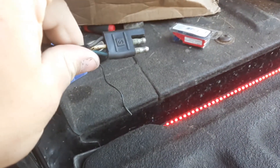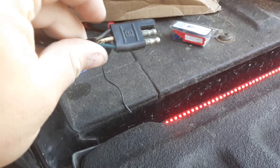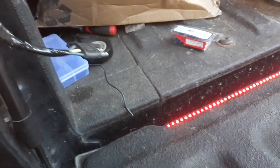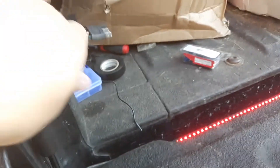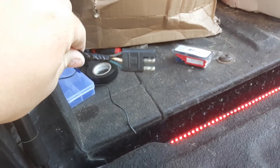The ground — for both the third brake light and the running light for the dome light — is run behind the tail light, connected to the tail light ground, and it works. Let me come underneath and show you how I have the brake light wired up.